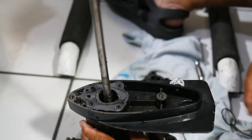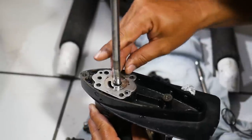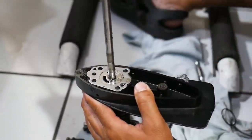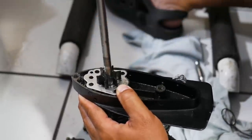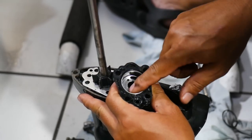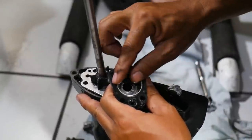Assembly is just putting it back in reverse order. You lay a gasket down first, then put the base plate on, then you've got your pin. Then the impeller — it's unidirectional because you have to have the slots facing down so it catches those pins. If you spin it, you'll feel it find that notch and sit down even farther. Plus you can check: if you spin the main shaft, the prop turns; otherwise it's stuck on there because of the pins. Next, prep the housing — the insert fits in one spot, it's got a notch it fits into, so it sits perfectly flat. And then always remember to add a new O-ring there, because that's going to seal the pump up and prevent leaks and keep the pressure up.